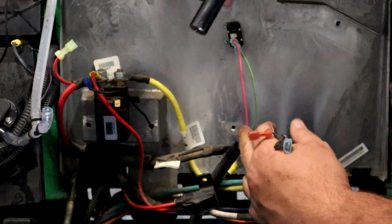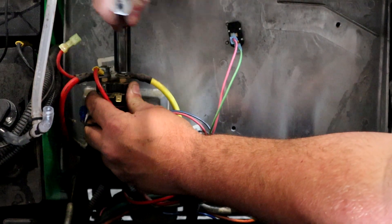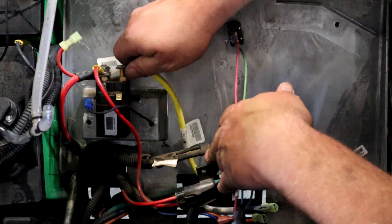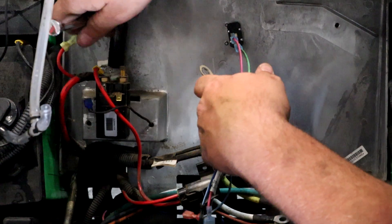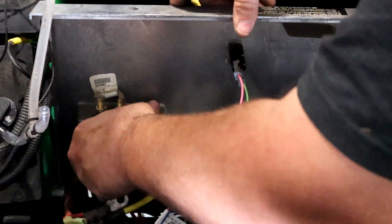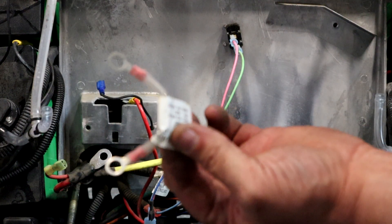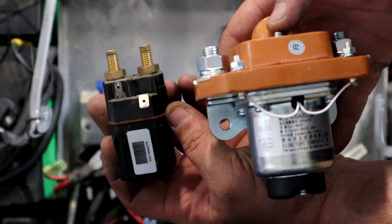Now that we've got the controller out of the way, we're going to take the half-inch again and disconnect the yellow wire and disconnect our red wire, then pop off our solenoid. You won't need this on the AC kit, so we'll get rid of that little bitty one. Now we can upgrade from the old solenoid to the new one — more power!